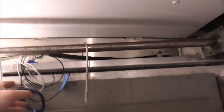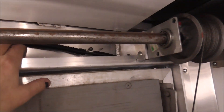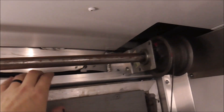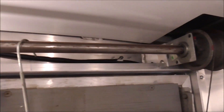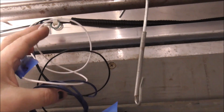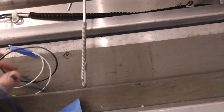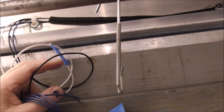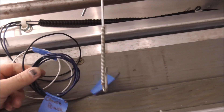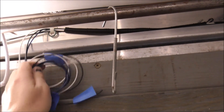One of the next things I want to get done is I want to get this panel all put back in place here on the back. I've added some wire loom to the existing wires just to help prevent any chafing. I've replaced all the factory scotch locks with heat shrink butt connectors. The white wire is ground, the black wire is the backup lights — when I put it in reverse it'll energize this wire. The blue is camera power, and you can set it up so that it triggers the camera when you put it in reverse. I'm not going to do it that way. I'm going to have it set up so that the camera always has available power when it's plugged in, so when you're driving down the road you can look behind you as well as when you're backing up.